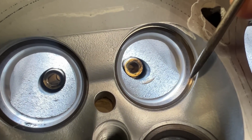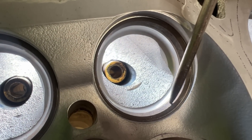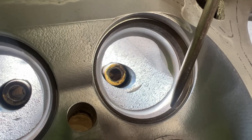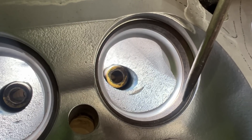The only thing that concerns me about the valve job — you're looking right here, there's the 45, and there's just a ledge here. I don't know what we can stick on it that's going to flow better, because the OEM just gave us no room to work with. A lot of guys always talk about five-angle valve jobs. A five-angle on this would just be a radius, and the valve seat needs to be thick enough to put actual five angles on it that would make sense. Most of the time you're going to do three to four angles, and actually three to four angles flow better than a five-angle.